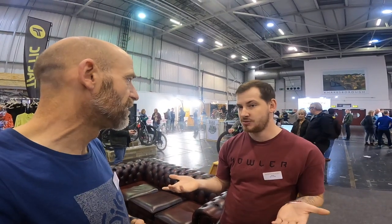Yeah, because it's got the linkage all in one area it makes that area look quite busy. It's also 27.5-inch, so with a smaller wheel you don't want to run it too low. What's the travel? It's 150 rear, 160 front, running a 205×60 trunnion. And if you run a 205×65 — so overstroke by 5mm — you can change it to 170/160.